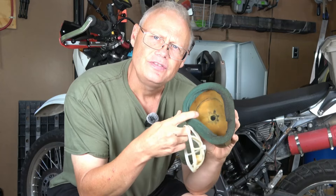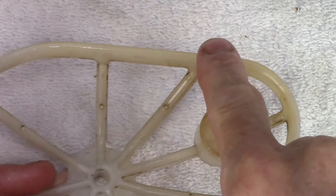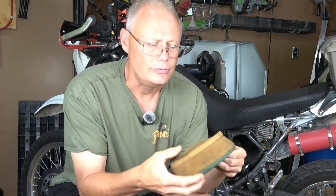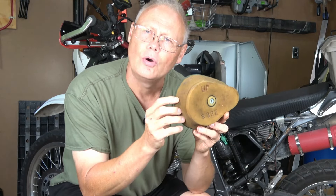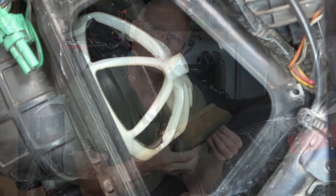The cage also fits inside the green portion of the air filter, and when you tighten it up it seals that green portion against the airbox, essentially forming a foam gasket held in place by the cage. The cage and filter have an orientation — if you look at the front of the stock filter, it will have 'UP' stamped into the foam, meaning it faces up. The pointy end goes to the right side of the motorcycle, which is your throttle side, and the fat side faces the airbox opening when the door is removed. When you put this in, you have to orient it around a plastic horn that's molded into the airbox to make sure it's sealed correctly.